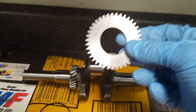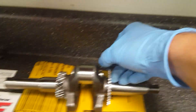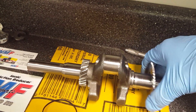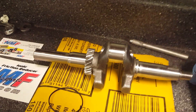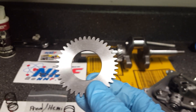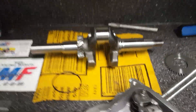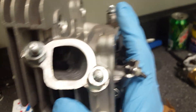This gear here runs your plastic governor gear inside the motor. It was pressed right onto that ring, so I just tapped it alternately with a screwdriver and hammer — tap twice here, tap twice there, and it wiggles off. Removing it decreases your rotational weight. If you decrease the rotational weight inside the engine, the engine will rev quicker and produce a little more horsepower. Since the governor's not inside the engine anymore, removing that gear off the crankshaft won't hurt a thing.